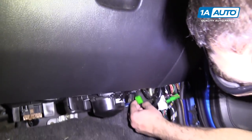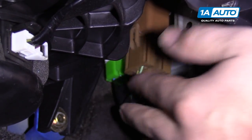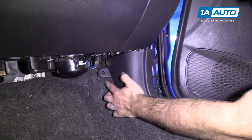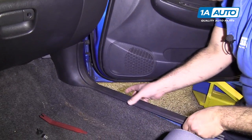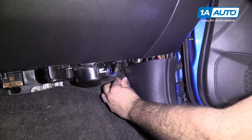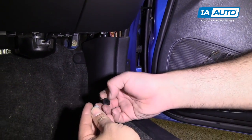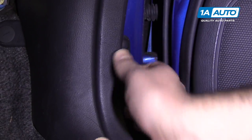Reconnect the green connector — it's up here on the other side of the brown connector. Push it up and it'll lock. Reinstall the trim panel — it goes around and sits over this little stud. Push it in place, clip it down, then line up the fastener and screw it on. Take the white part of the clip, push it into the body, then push the black pin in to lock it.